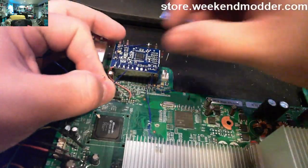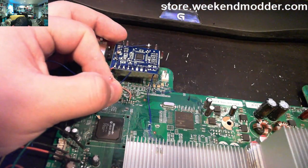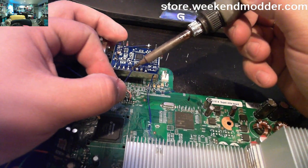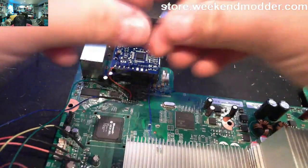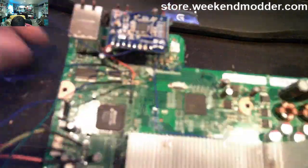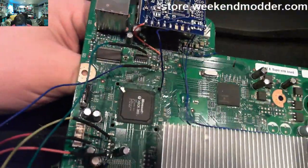So the final point that we're going to need to do is the standby clock or crystal, or basically the clock feed. So CLK, which is going to go to point C here. For this, I'm not using Kynar wire. I'm using a standard 28 or 30 AWG stranded wire. And as you can see, we just connect that first to the top, feed it right through the through hole